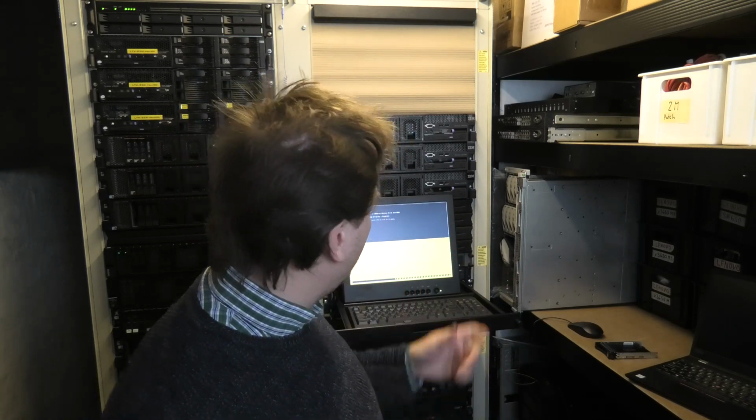So right now I've come down to I better firmware upgrade this server. I was sitting at my computer in the living room downloading new firmware for the server, and from the IMM, the management adapter in there, you can firmware upgrade the IMM and the UEFI firmware, kind of the main system. I can see that I haven't done that since 2017, so there is new firmware available. But I ran into the issue that you can't update that firmware while it's in the BIOS. So I had to get out of the BIOS to be able to sit comfortably in my living room office chair and update the firmware, and that's why we needed to load something so that I can go back and firmware update something. Let's go see how that works.